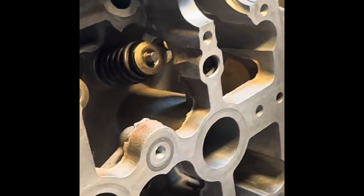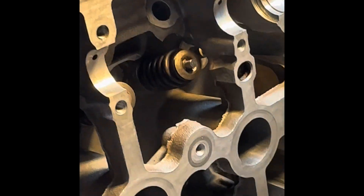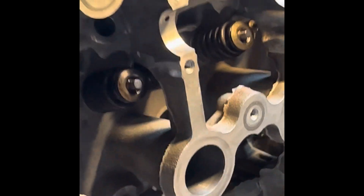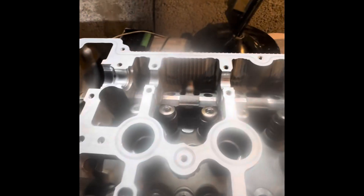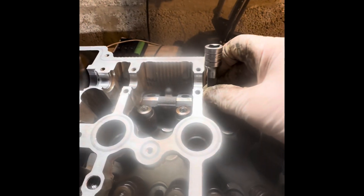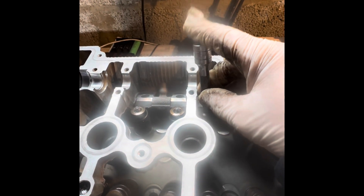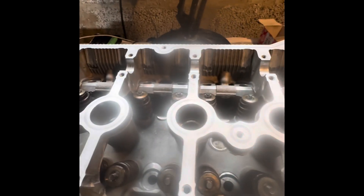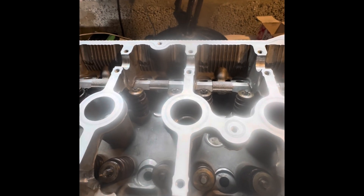So that's how you do that valve. I'm now going to quickly do the last one and then do all the inlets - I'll come back once all the valves and springs are in. What I do now is bounce the valves a bit just so you know it's all nice and seated, so the first time the valve bounces is not when you start the engine up. So we've done that now, and we can move on to the next stage.